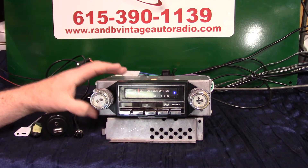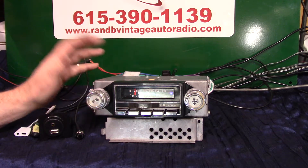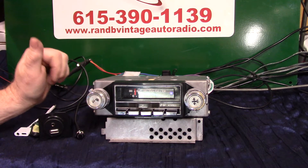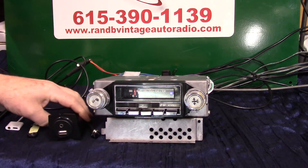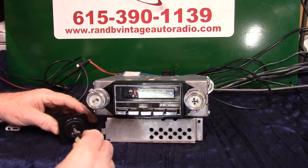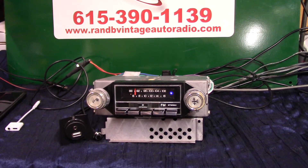It's AM and FM, and we've done a full Aurora Design conversion on it. It now has AM/FM, four channels out at 45 watts a channel stereo, has pre-outs on it if you want to add a sub or an amp to a set of rear speakers, has an auxiliary in which is automatic. There's also a USB port on the harness you'll be getting — it charges your phone and plays a thumb drive that comes with it, with the video on it and music. The files are built on it for you.